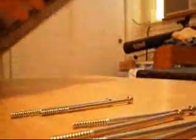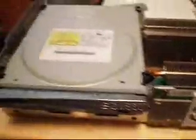Pretty much now you just want to take the Xbox, flip it — flip it where that metal shell is down now — and then just lift up. Once you lift up, it's going to look like this. Throw that over there with the other parts. Here's the inside of an Xbox. This is what you're going to be removing. You've already removed pretty much everything that you really need to remove to get this out, except for this back here, which I'm going to show you in a second. Let me go ahead and lift this out.